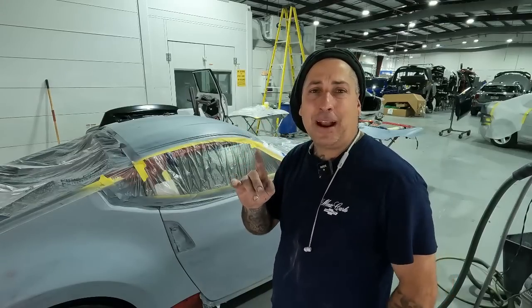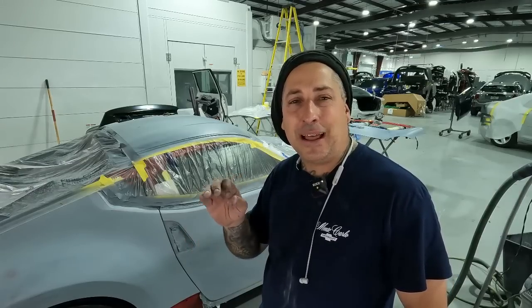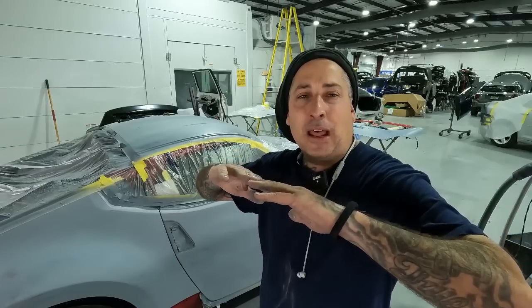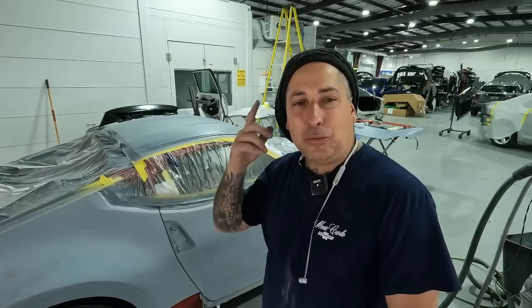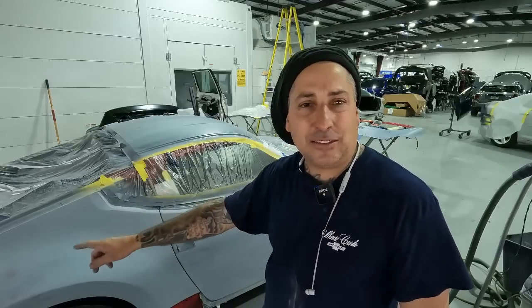And years back on my first paint job, I was actually in tech school and I painted my dad's Suburban, and the teacher said, don't hardline it, don't hardline it. And I ended up not listening to him. I hardlined the rear doors on a black Suburban, and I never could live with myself knowing that there was a line on that door, and I could always see it. So that stays with me from back then to now, that you never want to hard line up to your primer when you're spraying.